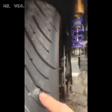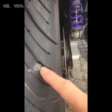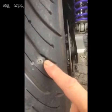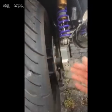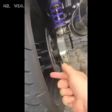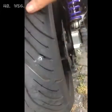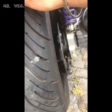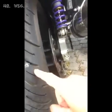In this case, I'm going to show you first the problem in a tire. As you can see, it's indicated there. There's a screw that went into his tire. In some cases, you can't see it. If you can't see it, the best thing is to top up with air on the valve, obviously, then put water on top, especially with Fairy liquid, mix it properly so you can see the bubbles coming out, and after that you know where to put the kit.